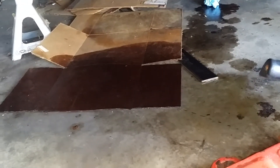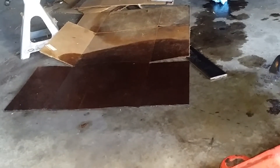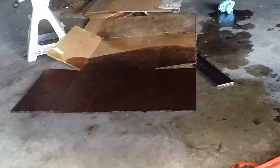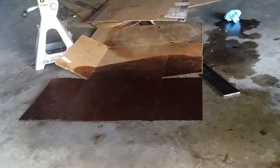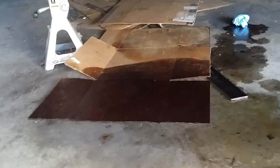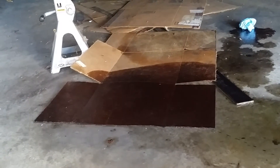The right rear looked pretty good, but it was still kind of dirty. When I got in the vehicle — because she's kind of small — I could pump it up and it would hold kind of pressure. But then I could put my foot in it, give it some really good force, and push it all the way to the floor. That's when I knew there was something wrong — I shouldn't be doing that.